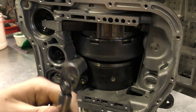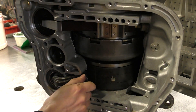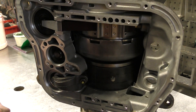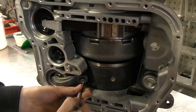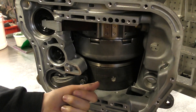I like to just run it in with the ratchet first, and then I'll get my torque wrench out — a quarter inch drive torque wrench set to 72 inch-pounds. And then what we're going to do for an automatic valve body is we're going to back this low band off three turns. One, two, three.